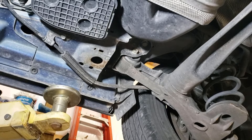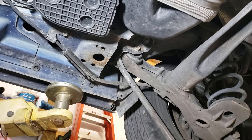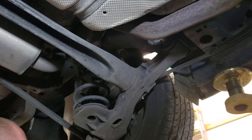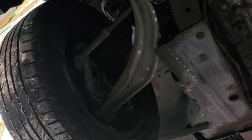As advertised, I'm going to take my suspension pry bar — and yes, that was a joke — and pull a little bit on the bushings. We'll do that on both sides. I like how that part looks over here, it's okay. We'll give the wheels a spin to make sure our wheel bearings don't sound bad, give it a little side-to-side pull. Same thing on the other side — spin it, make sure there's no noise. In this case there isn't; bushings are fine.